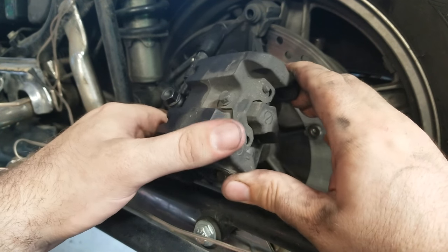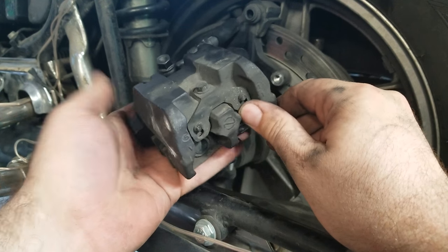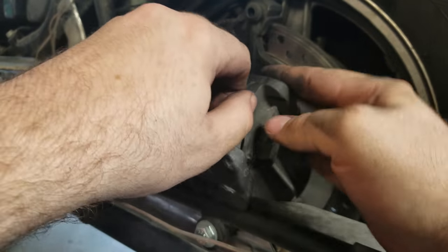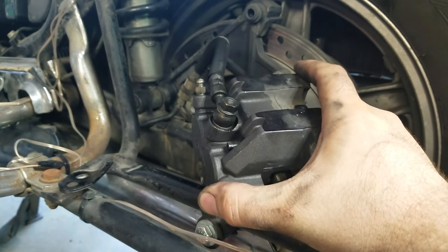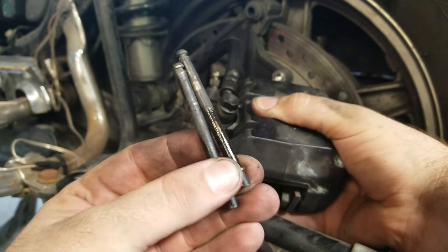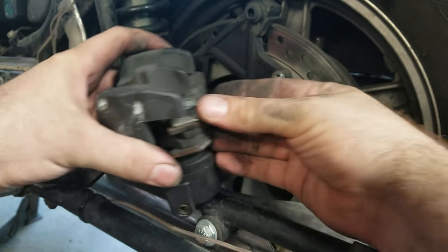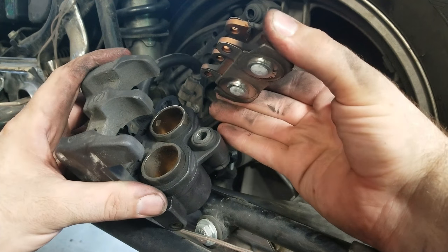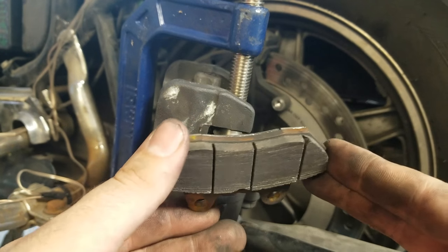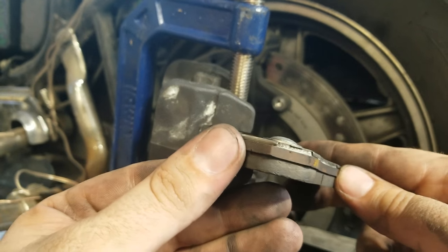Let's get these brake pads off. If you're looking at our rear brake here, you'll probably notice it's a little different from our front brake — we don't have little Allen bolts up here; we have this little bracket that we need to take off. I'm going to grab my wrench and get to it. Now I'm going to take the pins to the wire wheel, clean them up, and grease them back up. Our pads should come out directly — and there they are. We notice they've got shims on them, but they're built in and they're not coming off, so we're going to forget the shims.